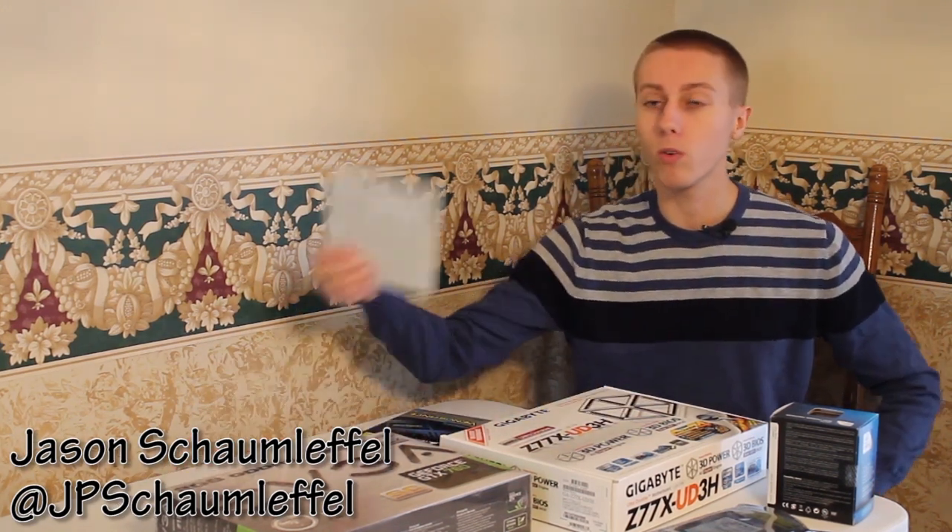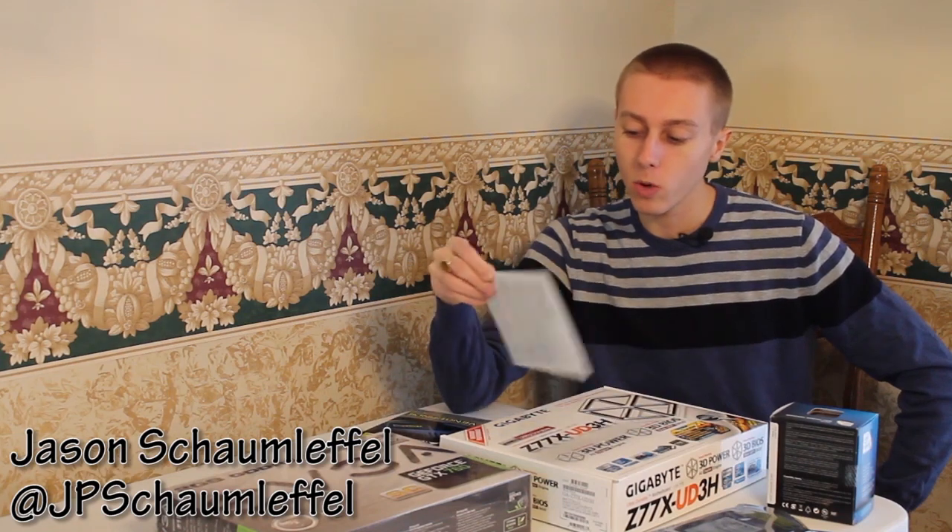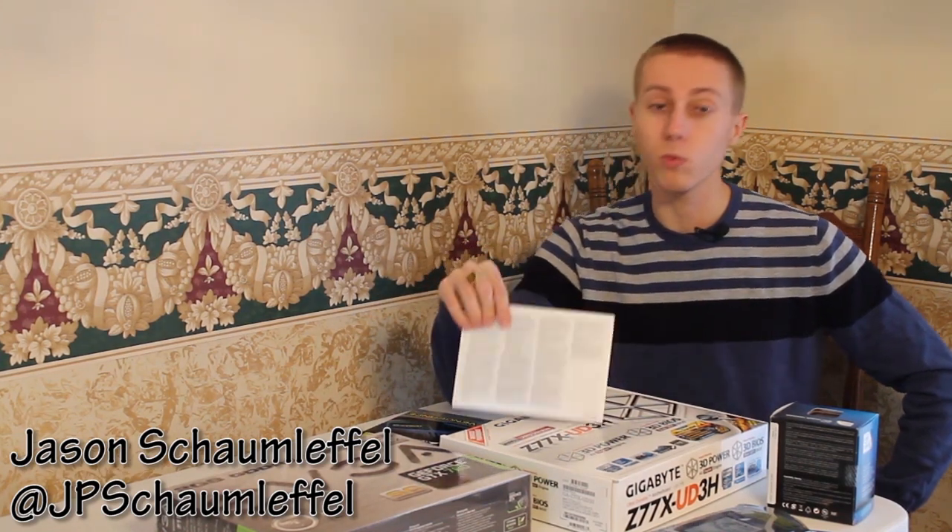I got a Windows 8.1 starter disk — this is what they would install on your computer for you. A lot of people in the mining community would rather use Linux or a special distro made for mining. But if I'm going to build a computer and put money into a system, one of the things people always talk about is how liquid your system is. If all the cryptocurrencies just plummeted tomorrow, you want to be able to resell parts of your computer, and just having Windows is nice for that. Also, I'm used to using CGMiner, and CGMiner is the best fit for Windows.